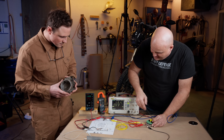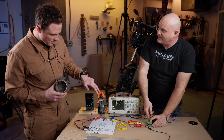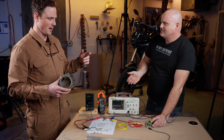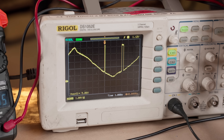We should see a nice, clean, gentle rise in voltage. But we can see a little blip — that blip is a bad connection inside here, probably from the spot on the wiper you're most commonly riding in. The ECU isn't smart enough to handle that spike: when it sees that little blip in voltage, it just thinks you've boosted the throttle, and it dumps a bunch of fuel in to compensate.